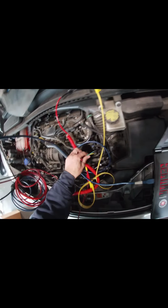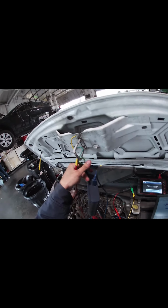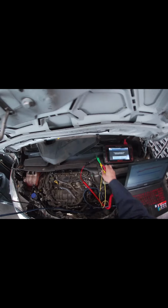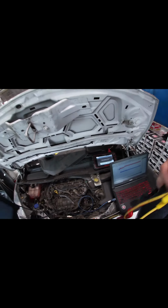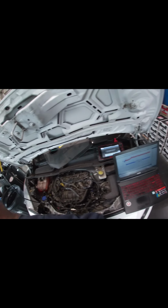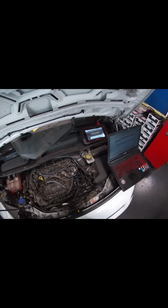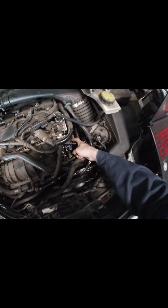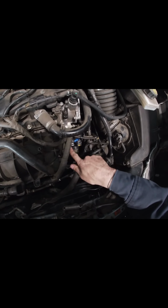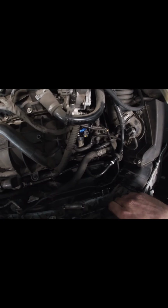That was a kind of a fun one. Voltage and a test light was enough. Test light was my load. And voltage told me everything. And ohms. Actually, ohms told me quite a bit on this one. Shorted coil and high resistance on the pin, so when you plug it in, you're getting no ground.